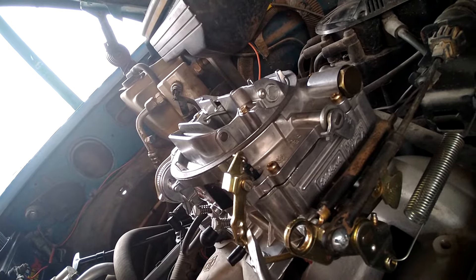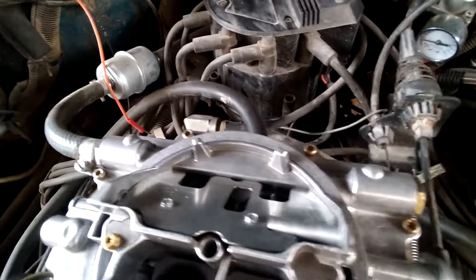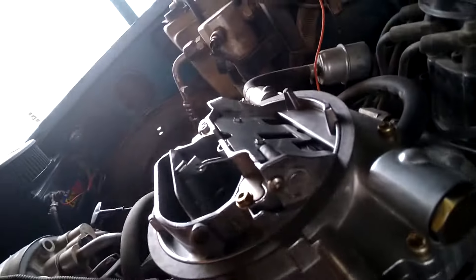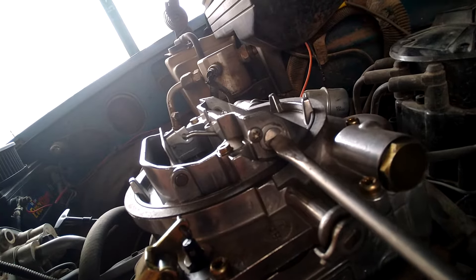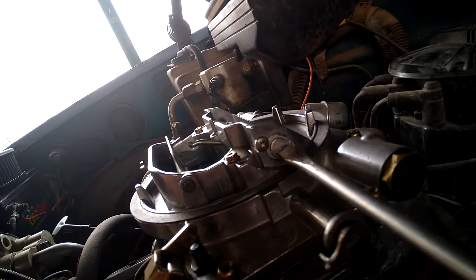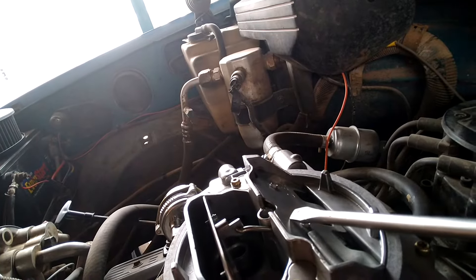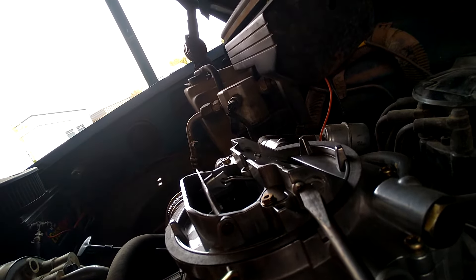On a stock engine nine out of ten times one of these holes will work. On the AVS2 there's actually a spring-loaded flap on the secondaries, with a little spring that spring-loads everything. There's a set screw here — this is your spring tension screw. Clockwise loosens the tension, counterclockwise tightens it. For factory setting, take that set screw off, let the spring tension unwind, turn it counterclockwise until the flap just shuts, then go a full turn and set your set screw. That is factory setting.